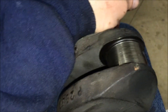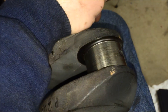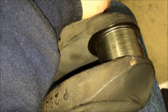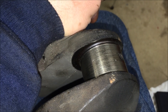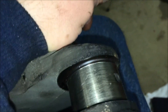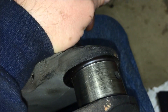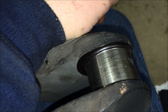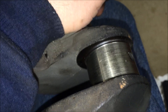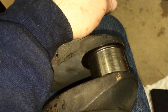I'm not sure what to do, to be honest. I don't know how far under you can get a rod for an Onan crank. If I'm at 1.595, I'm not sure how easy it is for a machine shop to turn it round. It might need to be turned to about 1.59, and if stock is 1.624, you're really talking about a 30 to 40 thousandths under rod — and I'm just not sure that exists. So that is my issue.